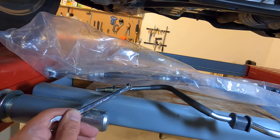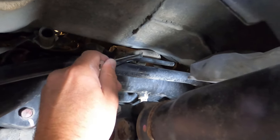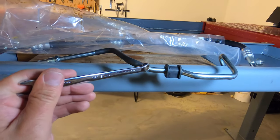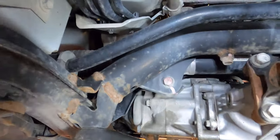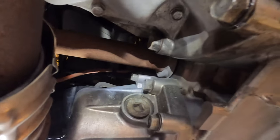Then there's a curve and it goes into the pump with a threaded piece. Similarly, up top it goes across, through a little bracket, curves, and goes into the steering rack. Now the trouble is you can't get access to the piece up top — there's just no room. You can't even see it, can't access it from the wheel either. That piece has to be done from the top; you have to reach down from the motor.